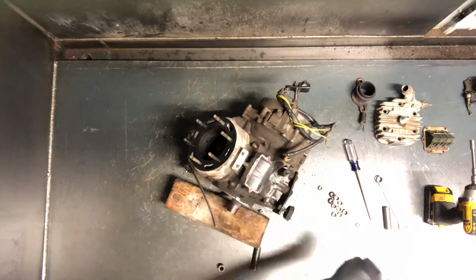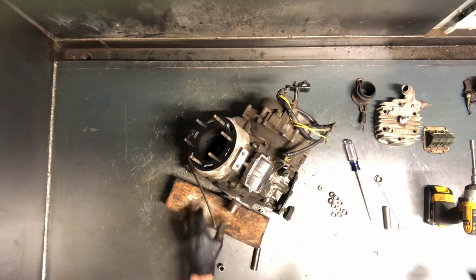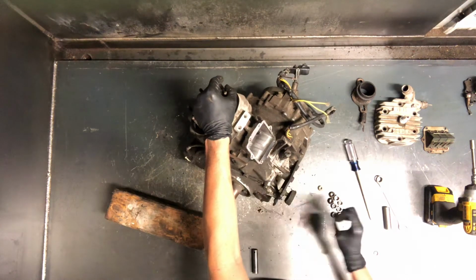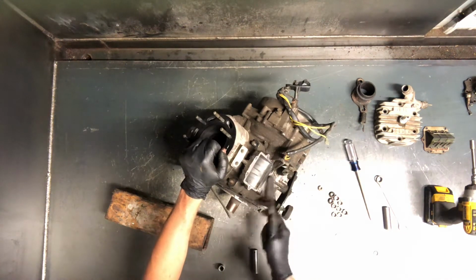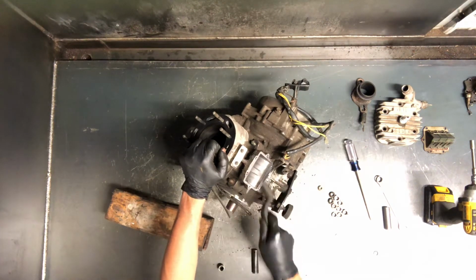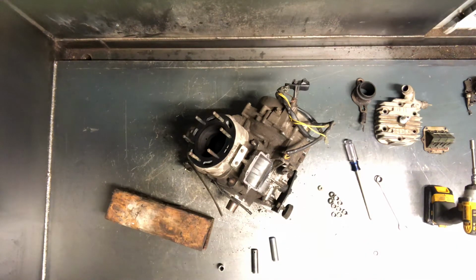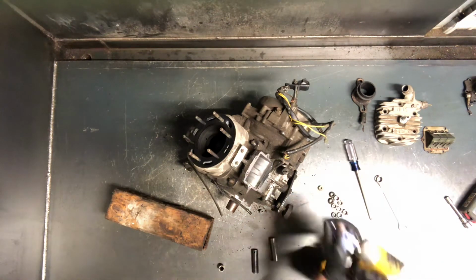All right, I've got your motor tipped up here. I'll show you a pretty common spot, and then I'll show you another spot later on. A pretty common spot for that crankcase to break is right in here. The reason why is that piston will come down, and if it comes down in pieces, it breaks the case in this area, because there's just hardly any clearance, like I said earlier. And we'll pull this motor mount now.